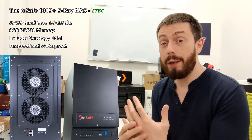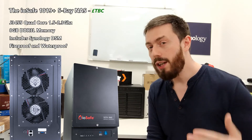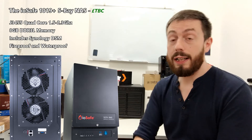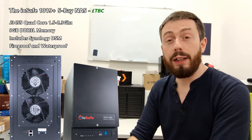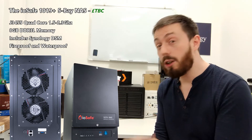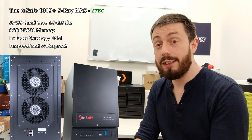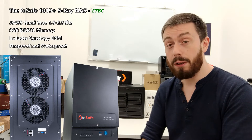It also arrives with data recovery services, so there's just another tier of many tiers of protection available with the IOSafe 1019. Because it arrives with the hardware and software of the DS1019+, almost all features are available to you: the J3455 Celeron CPU at 1.5GHz that can burst up to 2.3GHz per core, and 8GB of DDR3L memory at 1,866MHz — and you can't really upgrade beyond that, so it's a couple of sticks of four.